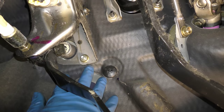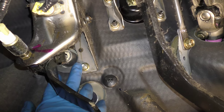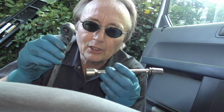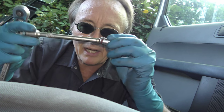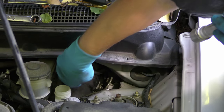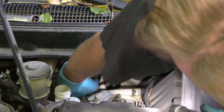We take this off the clutch pedal and remove these two bolts. You can see the bolts are up here and the other bolt is inside here — you can't see it very well, but you just have to reach inside and unbolt that stuff. Since those are hard to get to, I use a ratchet with one of these extensions that has a wiggling part on it, so it can go at an angle and you can get the bolts off easier. And off it comes — then with a big wiggle the whole thing comes out.